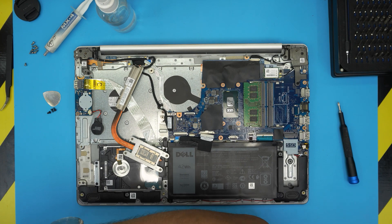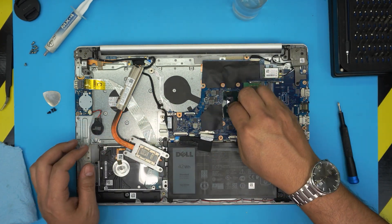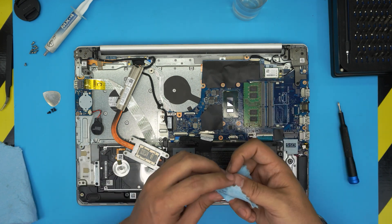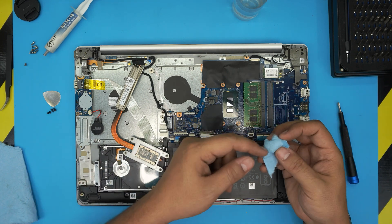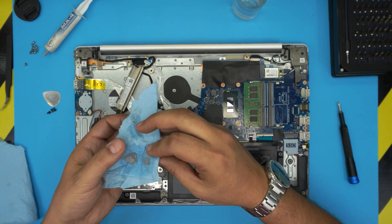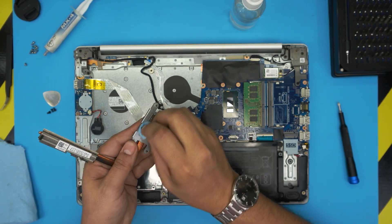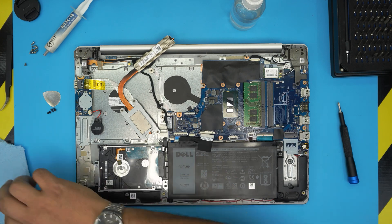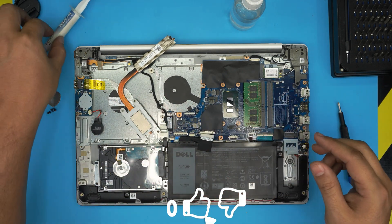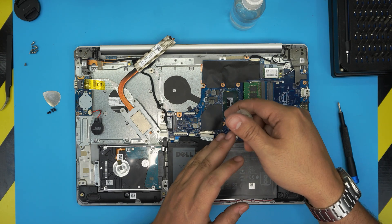There's your CPU. To clean it up, take a small piece of workshop towel, soak it in alcohol, and clean the die — the crystal die of the CPU. I recommend using a workshop towel rather than a regular towel, as regular towels leave dust particles. Use the same piece to clean up the excess paste on the heatsink block — rub it up and clean it nicely. Once you've finished both, use a clean part of the towel for one smooth final pass on the die.